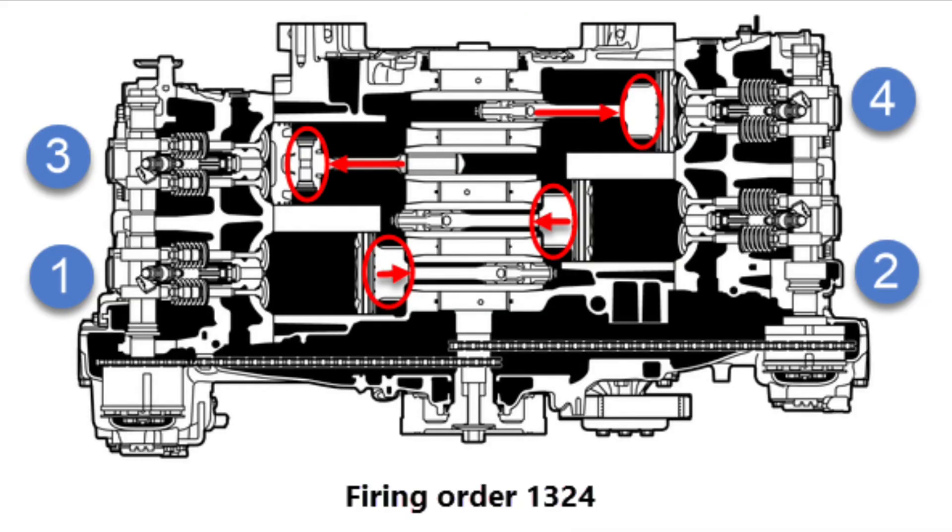When you look closely at the design of the exhaust flow paths, what you're going to see is that for the back two cylinders — cylinders number three and number four — those two cylinders actually have different exhaust port configurations. Cylinder number three, which is oftentimes right by a turbo, actually has a straight-through path for the exhaust ports to exit the combustion chamber and get into that header. Whereas cylinder number four has a totally different configuration — the exhaust port path actually slams right into the cylinder wall, has to make a right turn and then another right turn to exit the cylinder head. I'm going to rotate this engine so you guys can see exactly what I'm talking about.